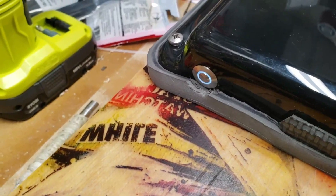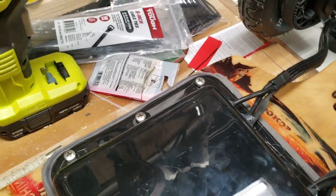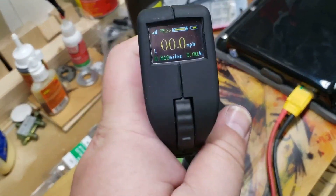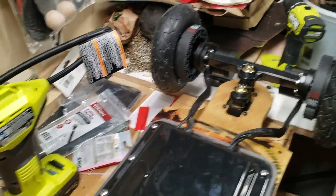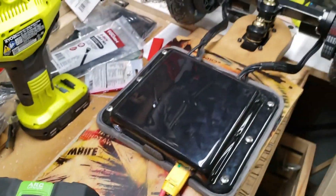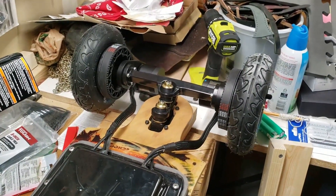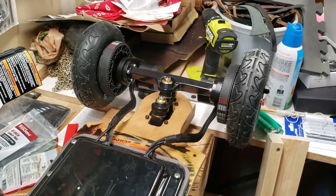There's still some issue with the vibrations, so I went through the Unity VESC tool again to see if I could find anything. I adjusted the throttle — the power input is set to 60 amps but I think this motor only pulls around 40 amps, so I adjusted that. I also adjusted the power curve on the throttle setting so it'll ramp up more gradually.